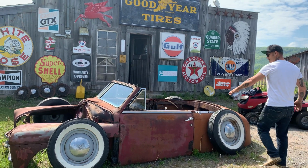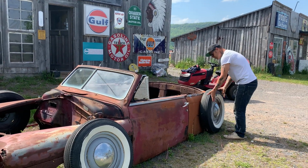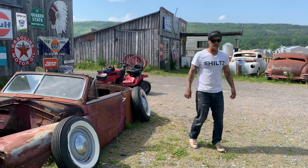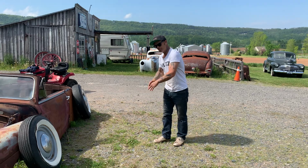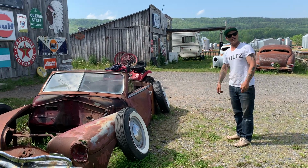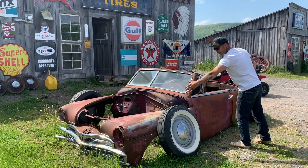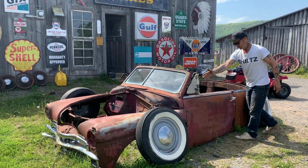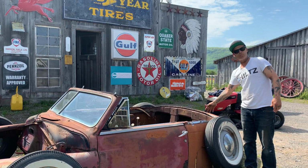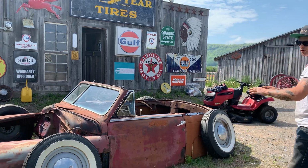I like the wheels like this on the outside, but I'm almost thinking that if I put the fenders on and then cut out the tops where the wheels went, that would probably look pretty cool too. I've seen a little bit of that going on. I've seen a few other things going on, but as I look at that car, that's how you would build it. If you want your truck or your car on the ground, put it on the ground and build your chassis there, and just build your bags decompressed. It seems pretty basic to me, but that's how I would do it. Clip that Camaro front clip, the rear end, 45 it down there by your feet, toe board, bring your front flat back, bring it up over top of the rear end, put your bags in it, get the air up, up she goes. And then you'd have a car that's that low to the ground. That's how you do that.